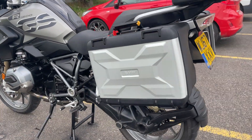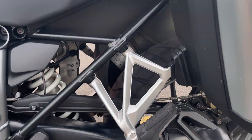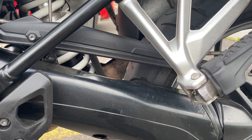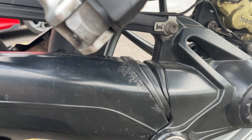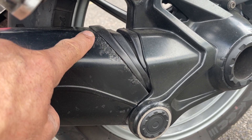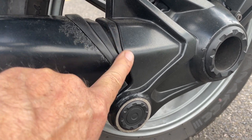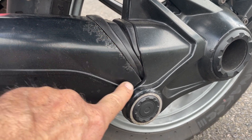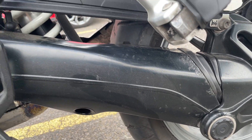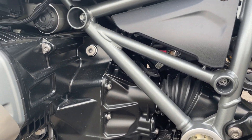67 reg, so last of the 1200s. This is the Euro 4 model — had the gearbox upgrades and the Euro 4 engine. You can see the corrosion's starting, just bubbling up the paint around there, but the seal's tight though, no dripping oil or anything. Unfortunately a bit of a trait on BMWs. Spring looks good — it's a low mileage one.